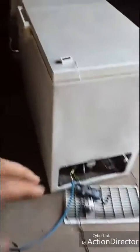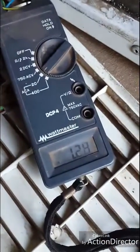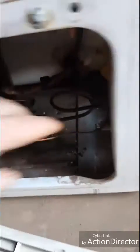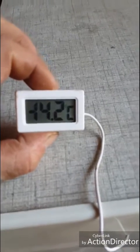The vacuum is done. All the lines are hooked up. I charged the system and let it run for the day. And this is where we're at on the amps — 1.2 amps. I can feel the capillary temperature is good, everything is good. The fridge is currently running at minus 14.2 degrees — so that's good.